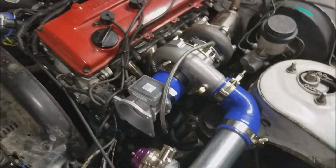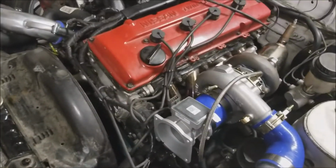I don't know. But needless to say, I made these little ghetto butt connectors, put them on there, started the car, and my AFRs went from 10 to roughly 13.5 to 14.5. It kind of fluctuated a little bit, because those connectors aren't the best, so I didn't have a perfectly great connection.